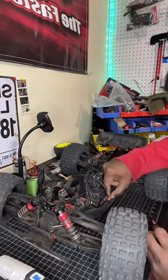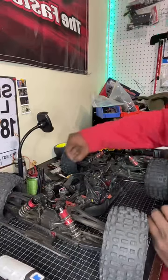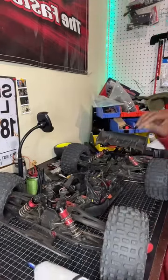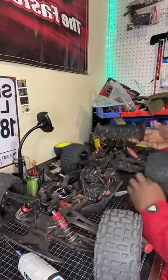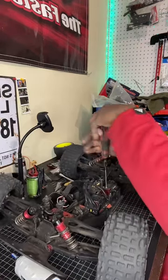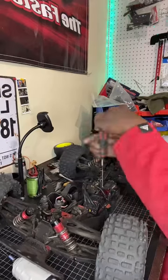We're gonna change out the system. I'm taking out this old BLX system. This thing, old dinosaur. Three mil to the top. Two screws holding in the motor. 3 millimeter. Hopefully I can just slide this motor right out without taking off the side guard.